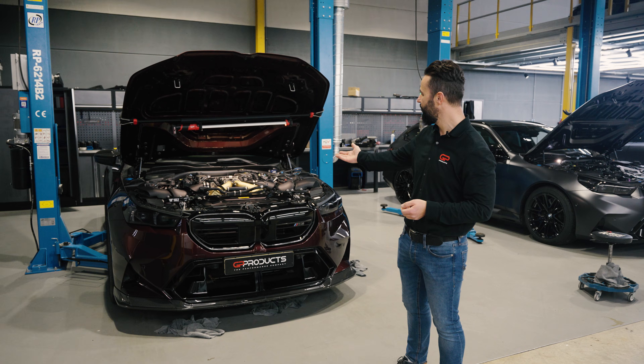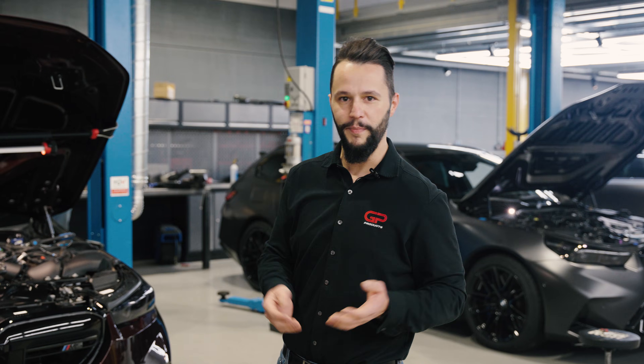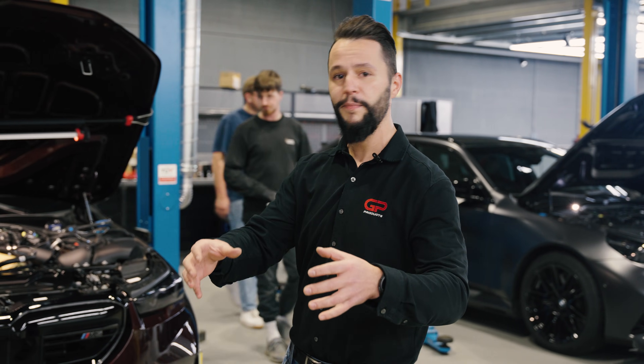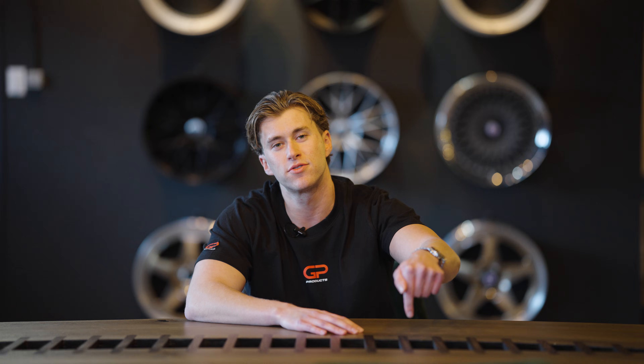There you have it guys — the BMW is ready. We have the CSF installed. It's an easy job: remove the OEM units, cut the mounting pins slightly because the CSF unit is a little bigger, put it in place, plug everything in — it's basically plug-and-play. Very coincidentally I couldn't make it for this video, but luckily my colleague Benjamin was up for the challenge — thank you very much, Benjamin. If you like our content and are up for the ride, click subscribe, click the like button, and I will see you next time.